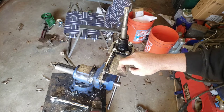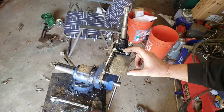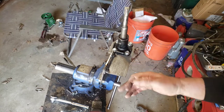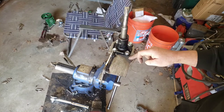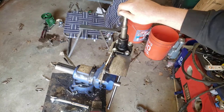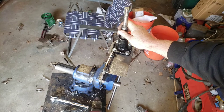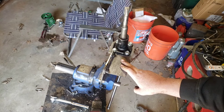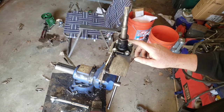I could probably brace it here to here, and that's going to be the extent of what I can do, because unfortunately I've got a pulley. The power steering pump pulley wants to be in this location, so that's what I've been messing with right now — trying to figure out how I'm going to install the Toyota Camry power steering pump. I'm having to drop it quite a bit lower than the crank, may still have to go lower yet, but I'm hoping I can clearance this out, and that there's enough strength here that this isn't going to move.